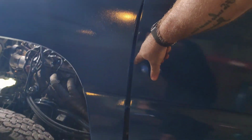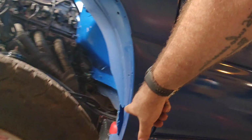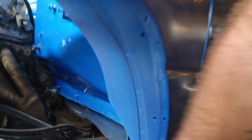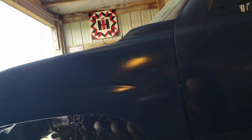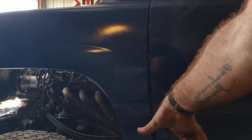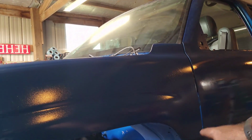And that'll actually solve this body line issue here. So the fender's mounted, but because these are so smashed and we've got these caps on up here, it's actually separating the body line. Then we'll be able to pick the cab up, and with that being fixed, that gap will close.